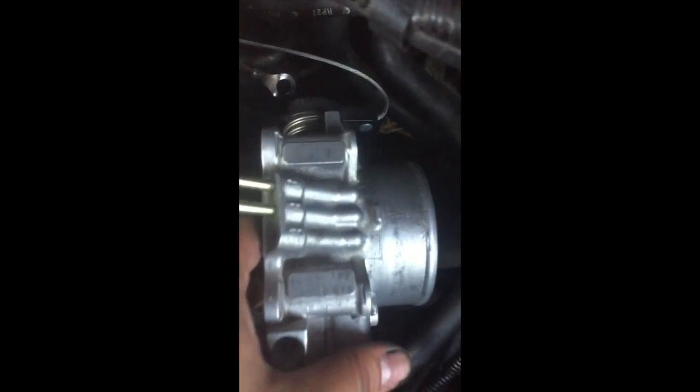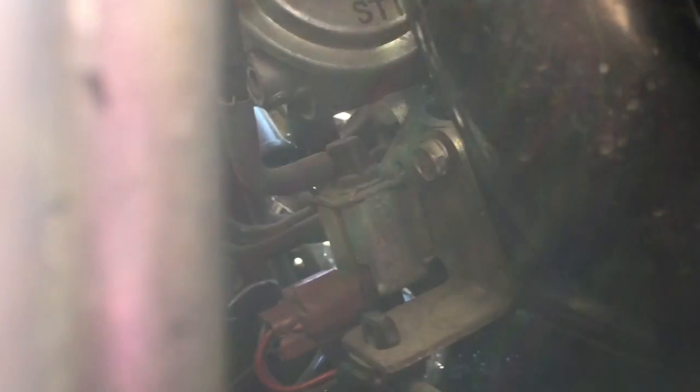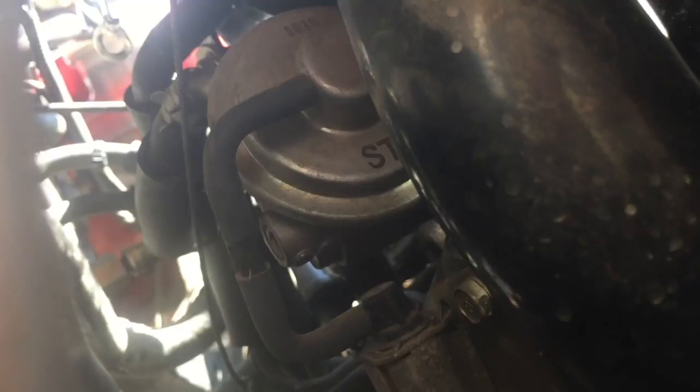You want to position it like this, then you'll be able to take this out or put it back in. This is the EGR valve — I'm going to show you guys how to take it off. It is located right back here. It looks to be facing this way. You're only going to see like a little hose and the top of it. We're going to go ahead and replace it, so I'm going to start by taking off that hose, and then taking off those bolts.